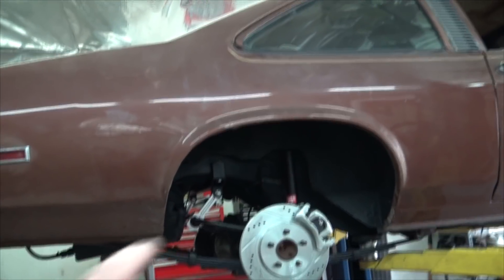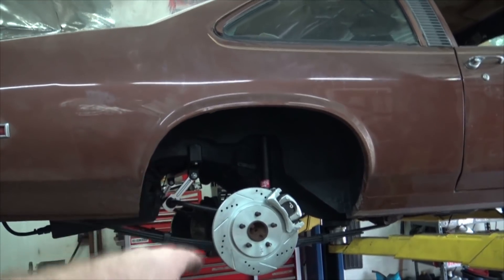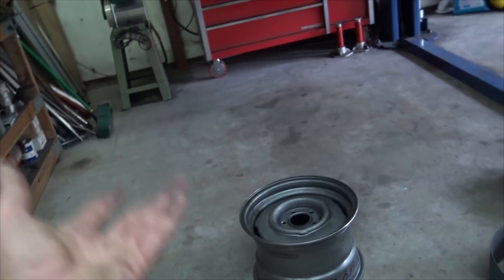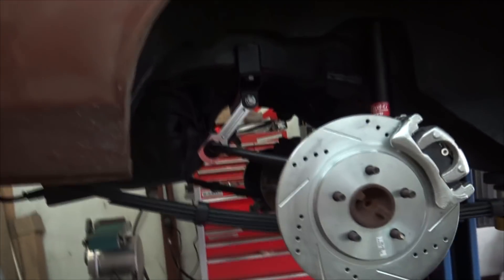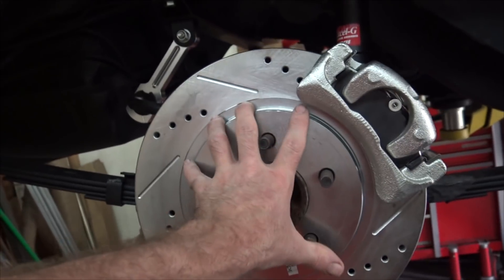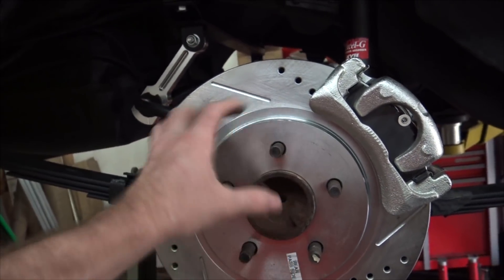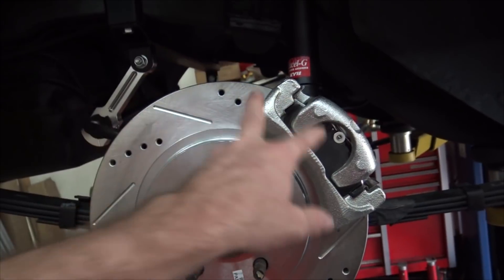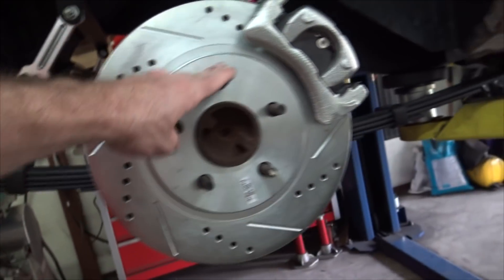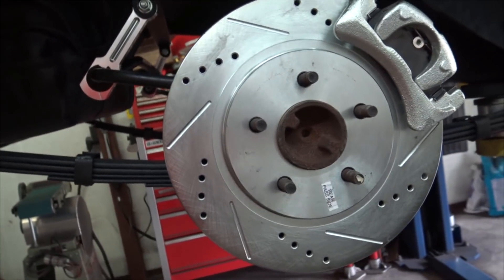They are kind of cool. If I had the earlier brakes - I think it's SN95 - they're smaller. Of course if I had those, the actual shorter ones, I wouldn't need the custom offset in the first place, I could just get a regular offset. I've went back and forth on whether I can retrofit the SN95 brakes, but their emergency/parking brake system is drum-inside-a-rotor, and the hangers are in different places and different sizes. I called LMR - they were really helpful, probably the guys to go to for all Mustang and Ford related questions and supplies.